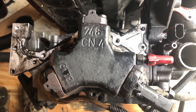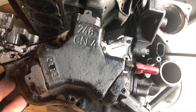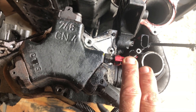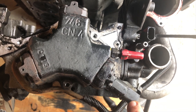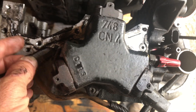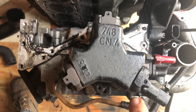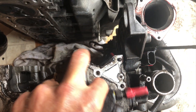This is the high pressure fuel pump as it sits on the engine block. Over here is where the low pressure fuel lines come and go; the high pressure comes out here and the electrical connection is there. Use a 14mm socket to pull the high pressure line off — you'll need to loosen it at both ends so you can swivel it out of the way, then a simple clip and pull the electrical connections. There's an E10 bolt that pulls out with a little metal plate that comes off and releases two hoses. You've got a bolt on the bottom, top left, top right, and then this will wiggle out. Maybe it's E11.